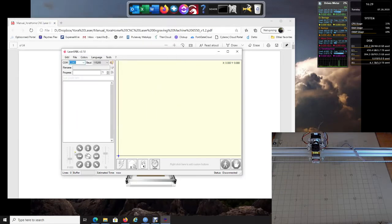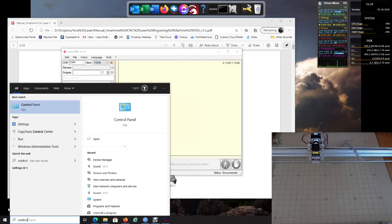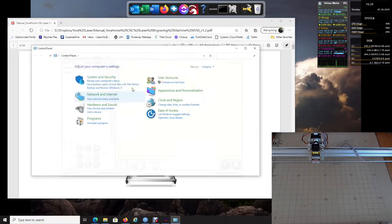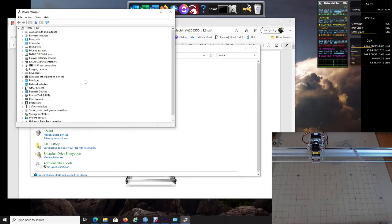If you don't have Windows 10 — say you have Windows 7 — click the Start button and type 'control panel.' If you just type 'control,' the first thing that comes up is Control Panel. In the top right there's a search — just type in 'device' and it will pull up Device Manager, which brings us to the exact same place. Click the arrow next to COM Ports and look for your CH340 COM port.